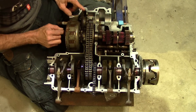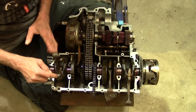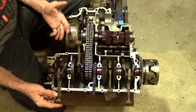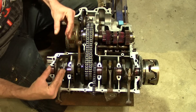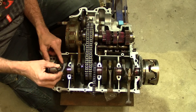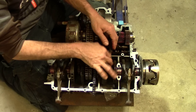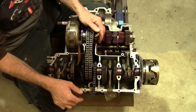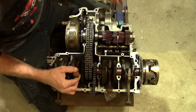That's a quick explanation of the clutch. What I'm after now is to verify that all of these connecting rod bolts have been replaced with new ones, because they stretch to yield — the original ones, later. Aftermarket bolts that you can reuse are available, but some of these bolts do stretch to a certain point, they stay there under torque, and if you try to use them again they won't stretch the same way. They can loosen up, and losing a rod would really ruin your otherwise perfectly good engine. If I didn't verify these were real replacement ones and they've been torqued properly, what if one comes loose after all this work? I've got to give the guy a call right now and see what's up with that.